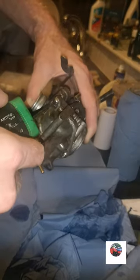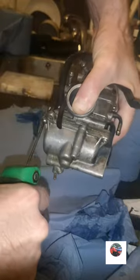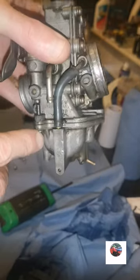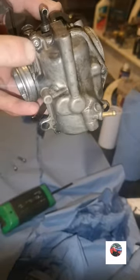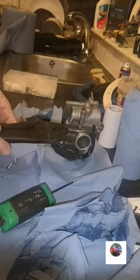Get these three little screws out of the bottom of the carb. Top two ought to get off. Put some new ones in. And that was it. I'll screw those out. And that one's rounded, but luckily somebody's put the wrong screws in. So I'll get the mole grips on that thread and take it out from there instead of chiseling it out. That's the mole grips slackened up. They won't move far, but you can see the head turning. So we'll get that off, and screw that screw up there.